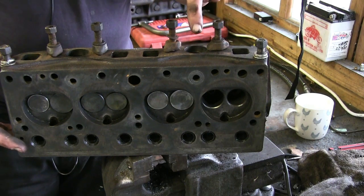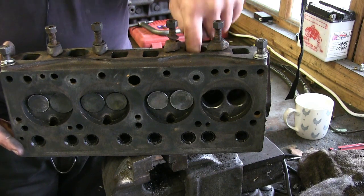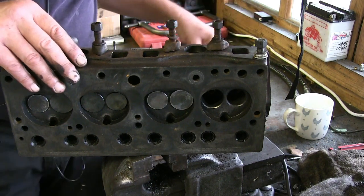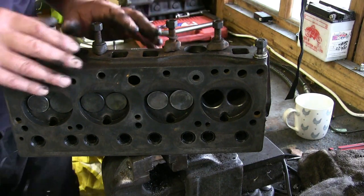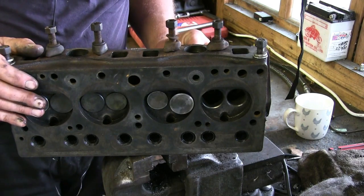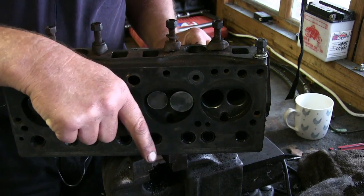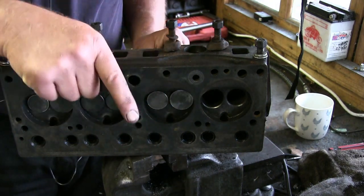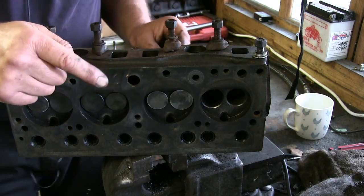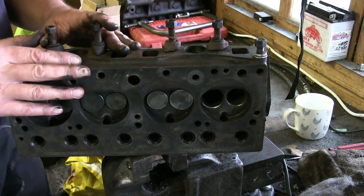But anyway, so you've got air and fuel, and don't forget, like I said to you before, 14.7, comes into the inlet manifold. It then services 2 valves. So an inlet valve will then open, bringing air and fuel into the cylinder, and when it's finished with the combustion, the exhaust opens up and brings out the burnt gases. Okay, so it's easy.